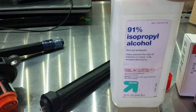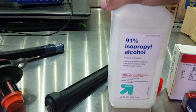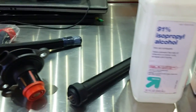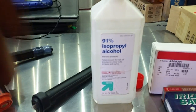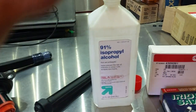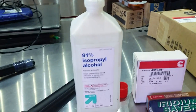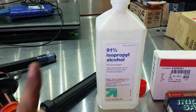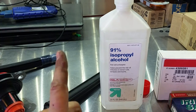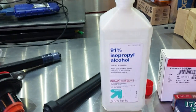And spark plugs — you need to clean off the ceramic prior to installation with alcohol. Use a magnetic spark plug socket, five-eighths, that's also been cleaned out with brake cleaner and blown out with shop air, or use a rag with alcohol to clean the socket out. Give it a really good wipe-down, especially if you only have one particular socket you use specifically for installation. Shop tip for the day — enjoy.